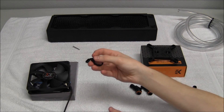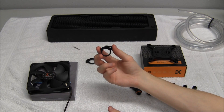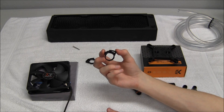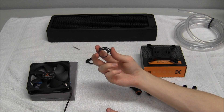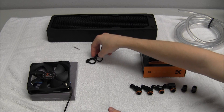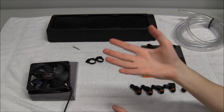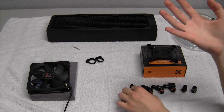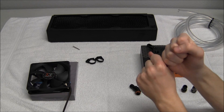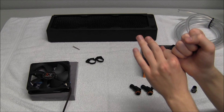For clamps, you have different kinds: metal clamps and plastic clamps. The plastic ones are the cheapest and work fine but don't look great. I would recommend metal reusable clamps. If you want a clampless-looking loop, you can use compression fittings — these fit over the tube and hold it in place without any leaks, and it looks like there's practically nothing there.